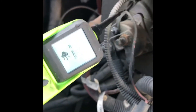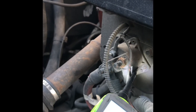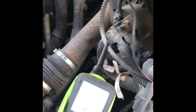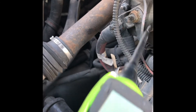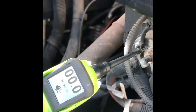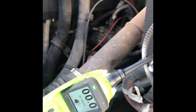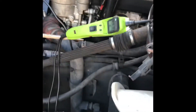A really small wire comes from your ignition switch. When you hit the key, 12 volts travels to the solenoid, it slams a contact shut, and essentially connects 12 volts to this wire that runs straight to your starter. What I'm going to do now is test this. I'm going to hit the key and we'll see if that's getting power — this is going to be hard to do by myself but you'll be able to hear it.